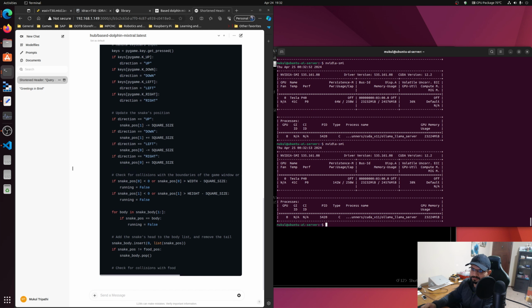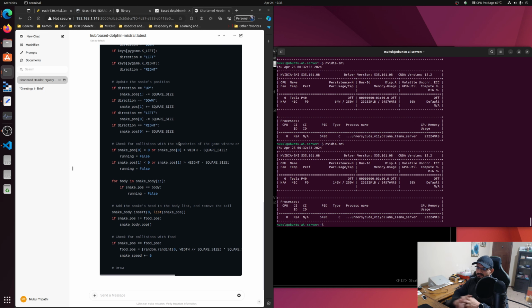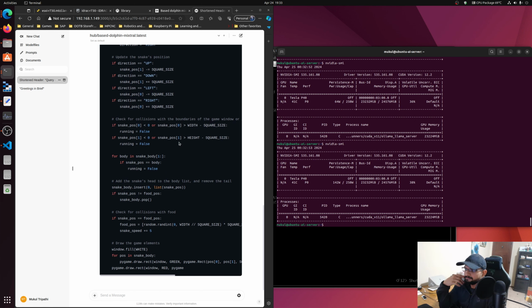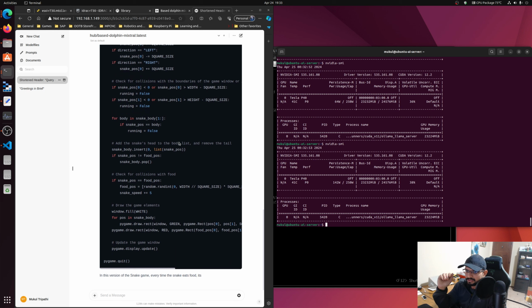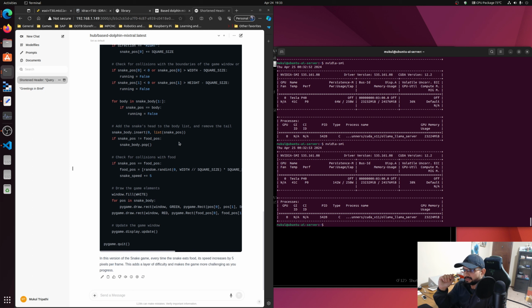Very interesting. All right. So I believe this is all I want to do today. This is where I'll stop, where we have Ollama set up on an Ubuntu server, R730, and we have our P40 graphics card over there. It's a headless server, and we are using Ollama Web UI on a Docker container running on the headless server for us.